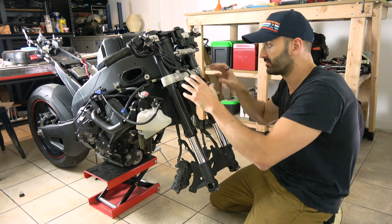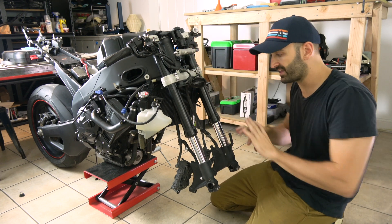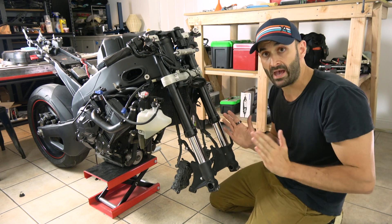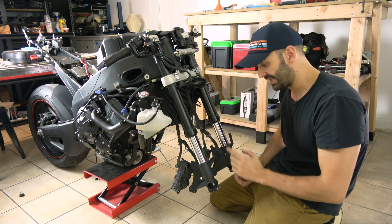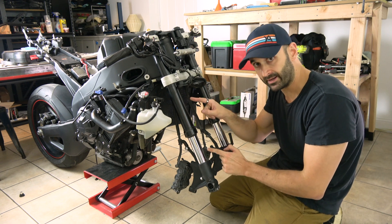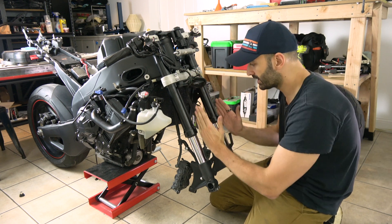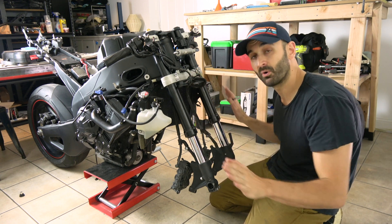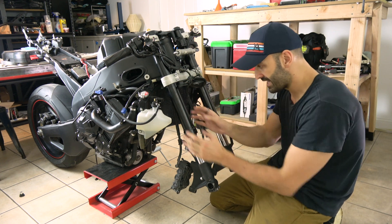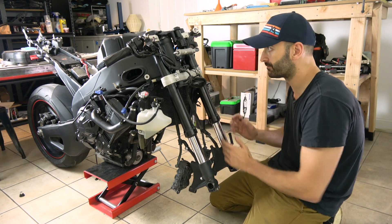So what is the correct tightening sequence to make sure the front end is going to be aligned when everything is set together? The entire system needs to be relaxed and working together. What we want at all cost is to have that inner tube and outer tube aligned. We want those axes right here to be parallel - that's what we want to keep in mind. We want this leg and this leg to be parallel, with the inner tube and outer tube aligned for each leg.